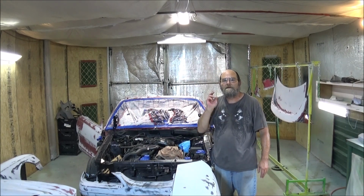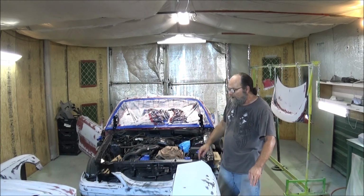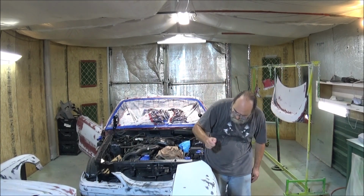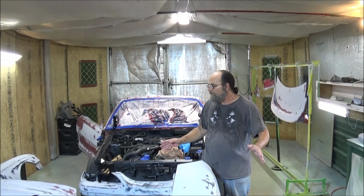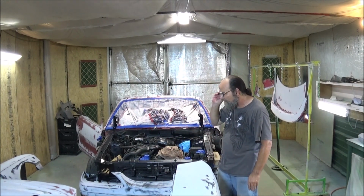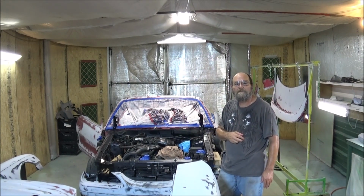Come back, and the last thing we're going to do is take a tack rag and go over everything, like you see that little piece right there. Like I say, you never know, so it's good to take a tack rag, go back over everything, look real close, and make sure there ain't no trash anywhere. Well, let's go take this lunch break and come back and do that. We'll start mixing the paint and getting the spray gun ready.